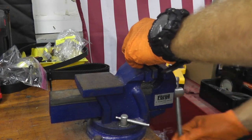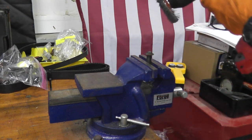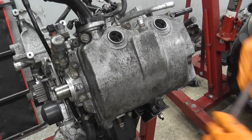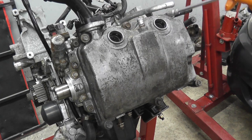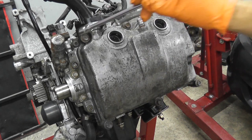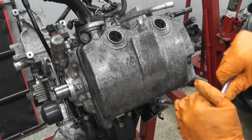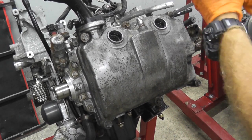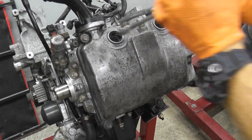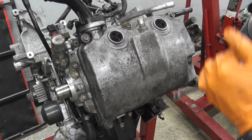The other thing I'm doing is cleaning off the ends of these fasteners with a very soft wire brush. To tighten down the valve cover, you're going to do a sequence just like before — A, B, C, D, E, F — it's only 5 foot-pounds and you're going to do it twice. Make sure it really sits on there. I don't have a torque wrench to read such a low number, so we'll just do it by hand. Don't make them too tight because they will break on you.